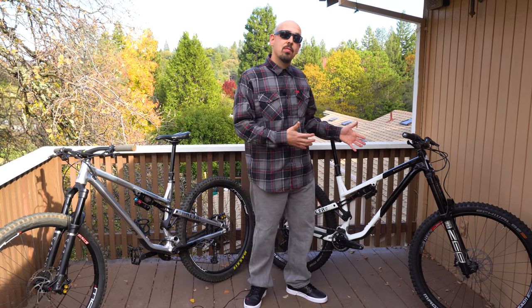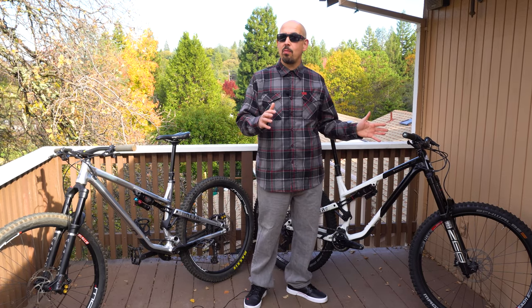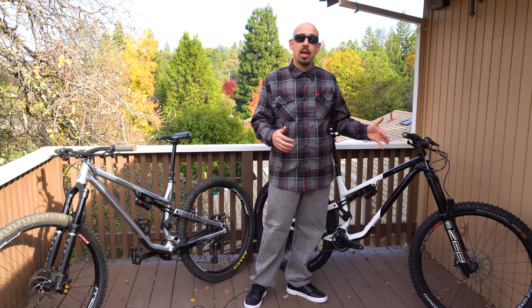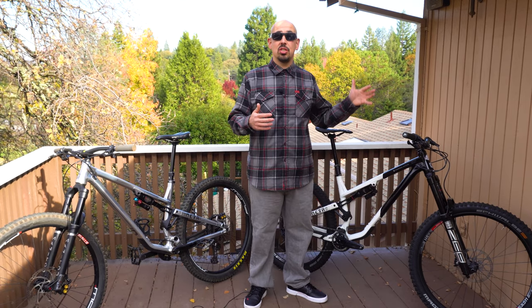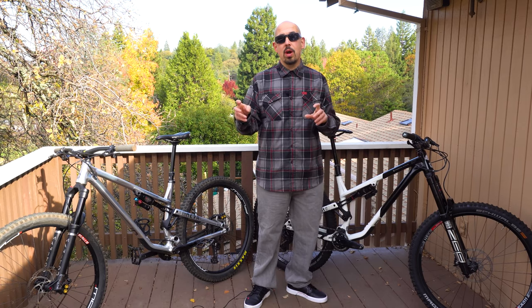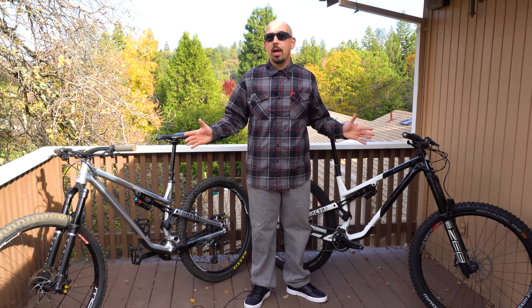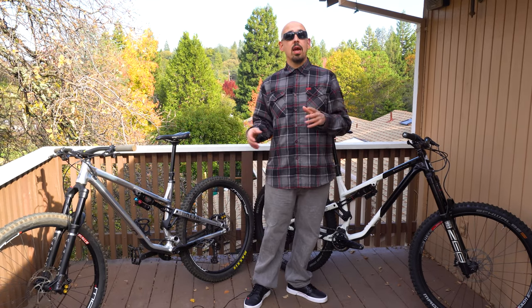The TR — you'd think it's a trail bike because it's labeled TR, but it actually has proper enduro category geometry. The AM version takes it further with a 1285–1295mm wheelbase and a 63.5-degree head tube angle. This bike is just a big huge monster that leans more into old freeride-style bikes than enduro. These bikes kind of blur the lines of their intended categories.